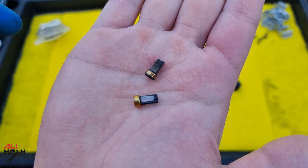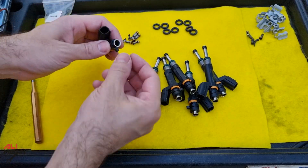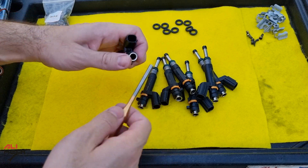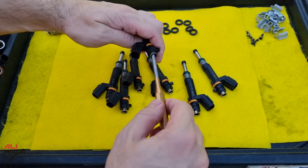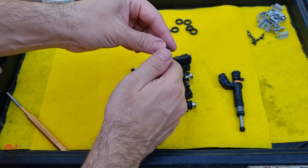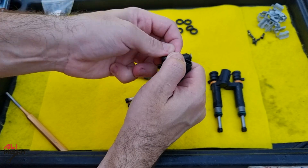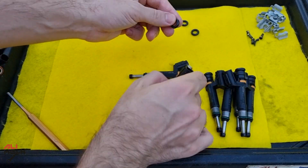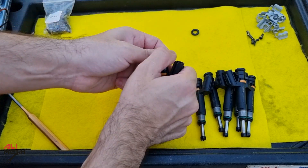Here's the comparison between the new and the old basket filters. Next, drop the new filter basket into the nozzle and give it a light push. I continued inserting filter baskets for the other fuel injectors. Next, installing a new set of O-rings on the fuel injectors. As I mentioned, if the old ones have no cracks you can reuse them, but it's better to use new ones so you don't have to worry about leaking fuel.